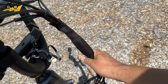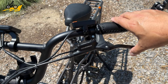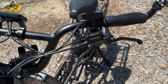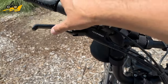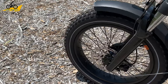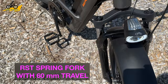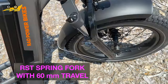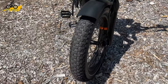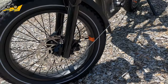For cable management they've used a neoprene wrap. You have Tektro hydraulic brakes, which is a really key feature. Everybody who jumps on this says they like the brakes - super soft, you can use almost a finger to push them in. Tektro is a big name brand, and you have motor inhibitors so once you pull the brake it shuts off the motor so it doesn't fight against the braking. 180-millimeter rotors is another reason why these work so well. You also have a quick release on the front, and preload adjustments and lockouts for the front suspension. If you want an even softer ride, you can bring down the tire pressures - I usually run about 5 psi lower than the max.